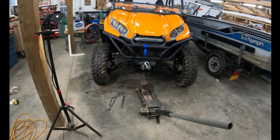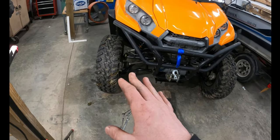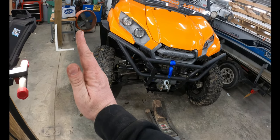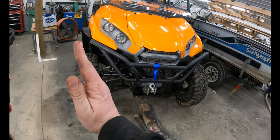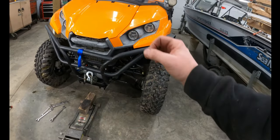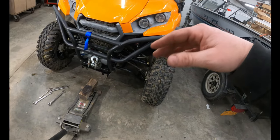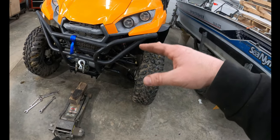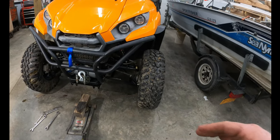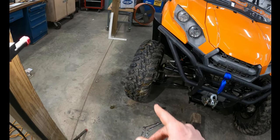That's why it's so important to get in and turn your wheel after you make an adjustment. When I let it down, that whole wheel had positive camber — this side did too. When I got in and turned the wheel, the whole front end started sagging down because the springs had preload left in them. The tires were keeping it from settling back into its static position, which I believe it's now at. Let's re-measure.